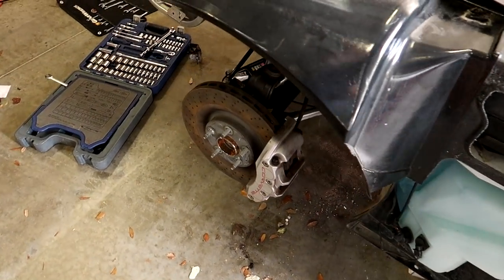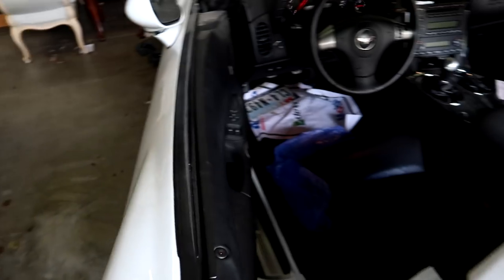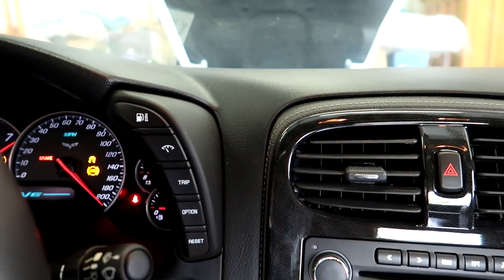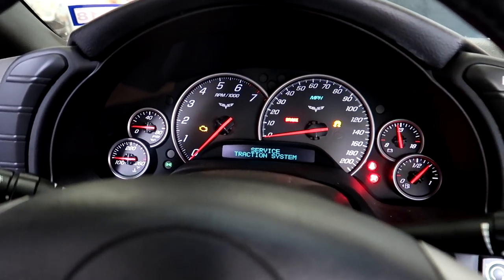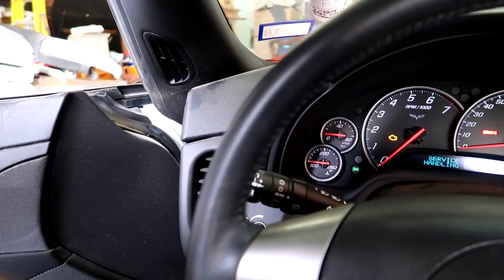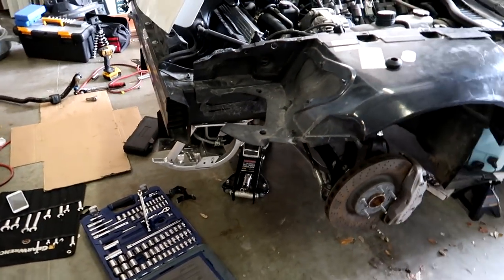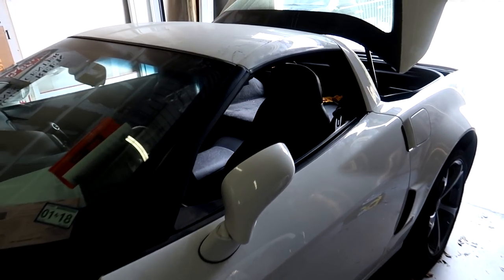The car is off the ground. Pretty much everything is hooked up except for getting that air intake on — the MAF is not hooked up. But there is something new happening, which is, in my opinion, a good sign. I've got my key in hand, I've got a red light on here. When I close the door, it gives me the green light. You do hear the relays clicking, and I don't know if that's a fuel pump noise or what, but it's definitely better than before — before we were getting pretty much nothing. Still a lot of the same messages. Now the reason we're working on the suspension: number one, it's got to get done so we can finish the car. And number two, somebody told me that the reason my car is not starting is because the front end is jacked up. I really find that hard to believe, but we're about to find out. Once we get that sway bar on, we'll be able to lower it on the ground and see if that's what fixes our Corvette not starting.